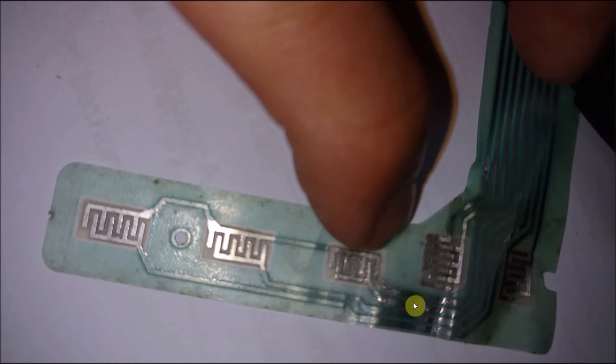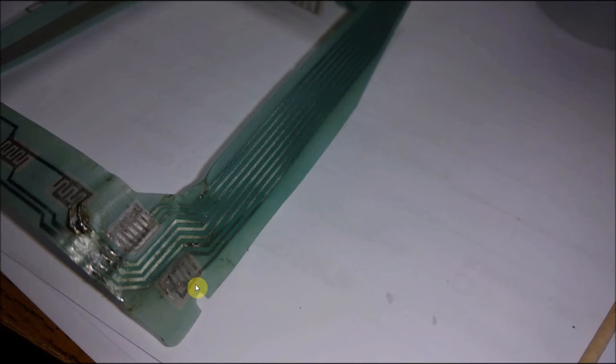And just repair these traces right here, here, and up here with, again, just scraping off very gently. You have to be very careful. You don't want to scrape away the actual wire. But just be very gentle. Scrape off nice and easy. Put some flux down, and you can resolder your joints and save a circuit that would have been garbage otherwise. And this is just another shot of these spots I needed to repair.